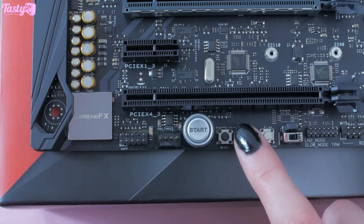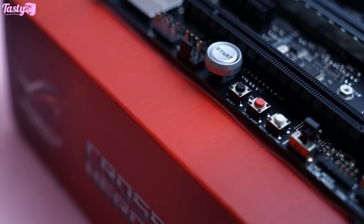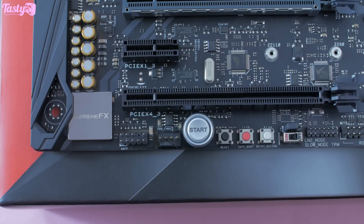These two buttons here are going to come in very handy when overclocking. This one is a safe boot button, which will temporarily change the board settings so that you can safely get into the BIOS if your overclock has stopped you from being able to get that far, while still retaining the last settings you used that didn't work — so you can tweak it without having to start from scratch, which is just great. And then this is a retry button, which will just restart the system if you're struggling to boot into Windows. So if you have an overclock that's right on the edge of being stable causing you to have trouble booting, you can just keep jamming this button until you're in, and then you just have to hope you can get the screenshot in time. Buttons like this really make me want to have another go at really pushing a CPU's overclock.